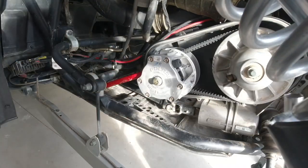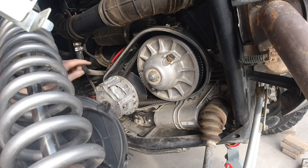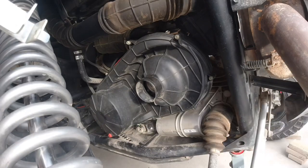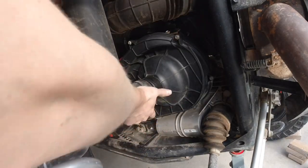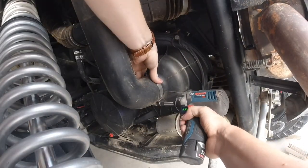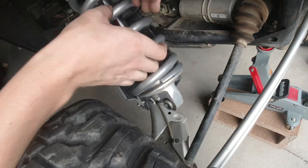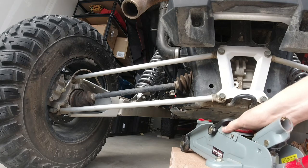There's 95 foot-pounds and we are good to go. Let's get the rod slid out of here. As you're doing this, make sure you haven't lost the seal in here — sometimes that can pop off with the cover, so just make sure that's still in there. Slide the cover right back on and tighten that up, then this little bracket up here. Now it's time to swing this shock back into place. Jacks off — let's see how this clutch works.